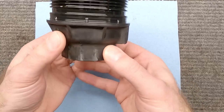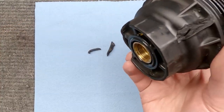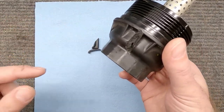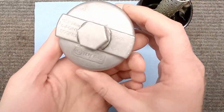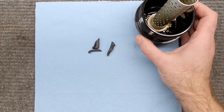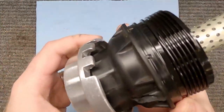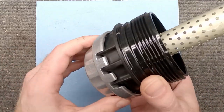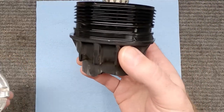Here's the housing that I had taken off that I had busted — the pieces I busted off the edge, and then ultimately the tab busted off the side, which is why I had to replace it with a new unit. I would not recommend this tool. While it is a Toyota filter remover, I would recommend either one like this or one like this so you can get down there and fit around the tabs — much better feel. Really what you should do is just not over-tighten this down when you're installing it.